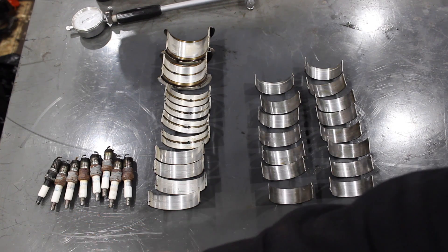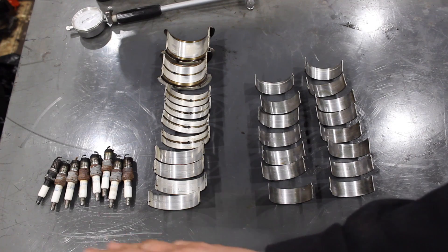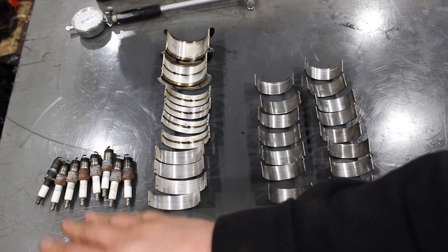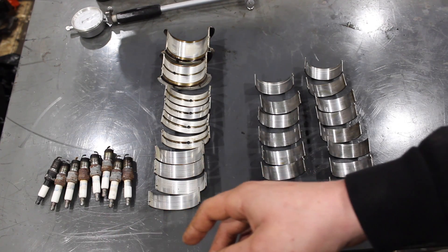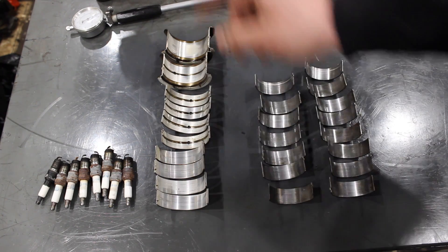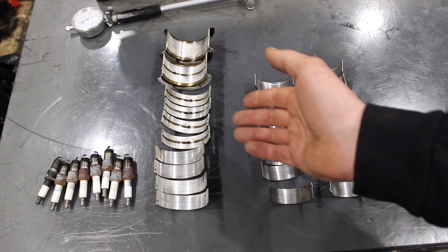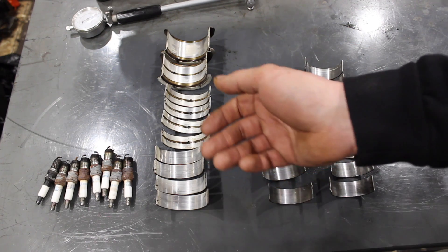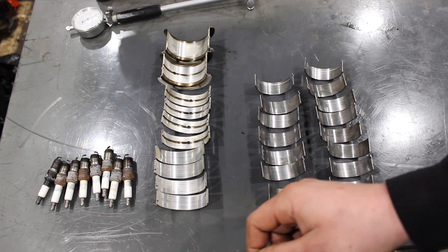You're just looking for extreme oil burning or weird issues. Even though you are rebuilding this thing, it's good to have an indication of what this engine was like prior — especially with these budget builds when we're not doing a full rebuild. The crank bearings look fairly good, really good considering this thing had about 120,000 miles or close to 200,000 kilometers on it. Everything is looking really good, pretty normal for these Vortecs.